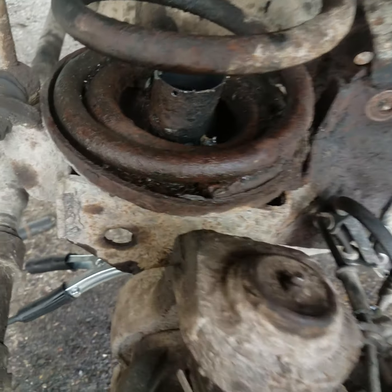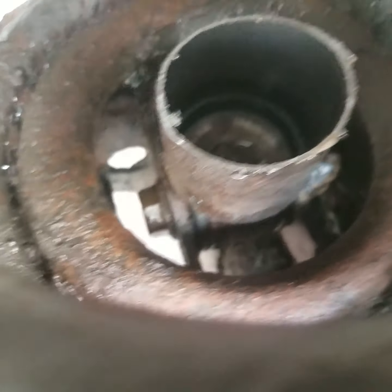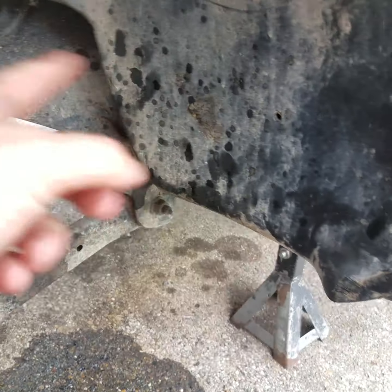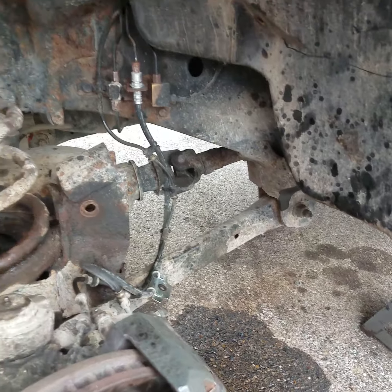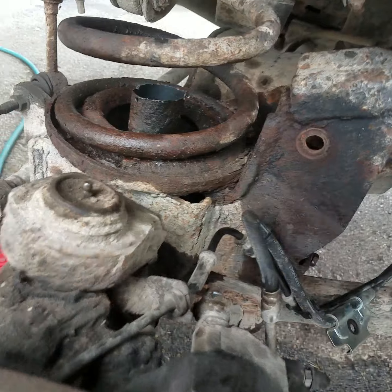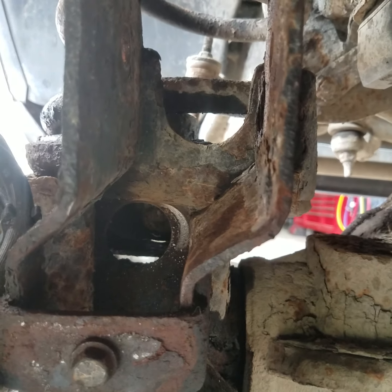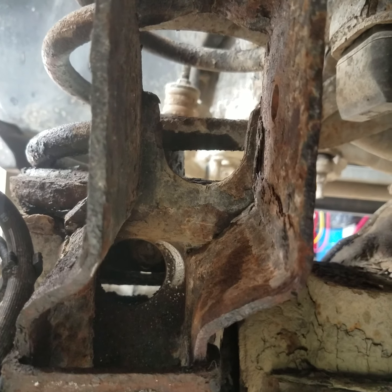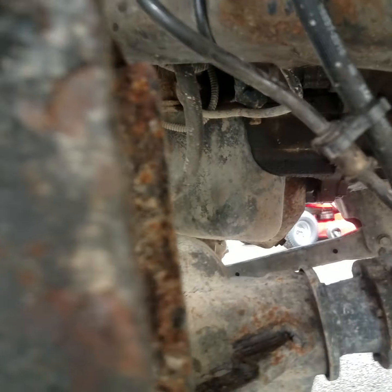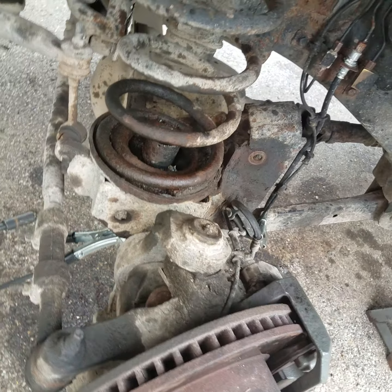So like I said, you can either use a welder — tack weld the slug in place, undo that bolt, pull it right out — or if you don't have a welder, go right in there behind it underneath, drill that seven-eighths hole out to an inch and a half with a hole saw, and you can reach right in there on the back side of the slug with a nut extractor.